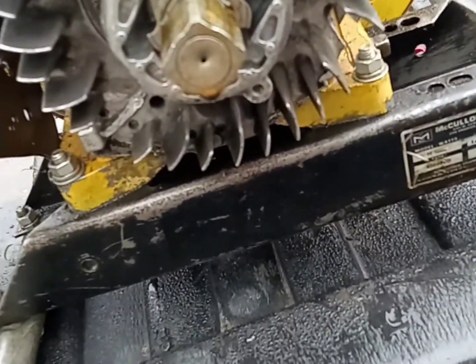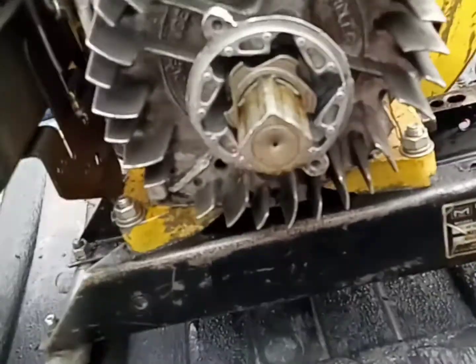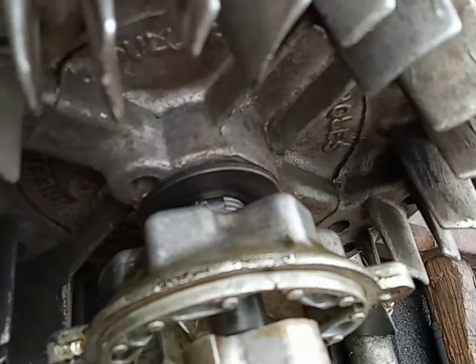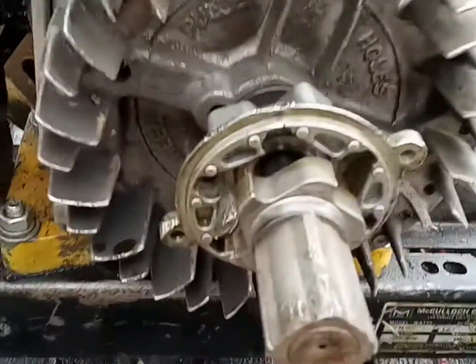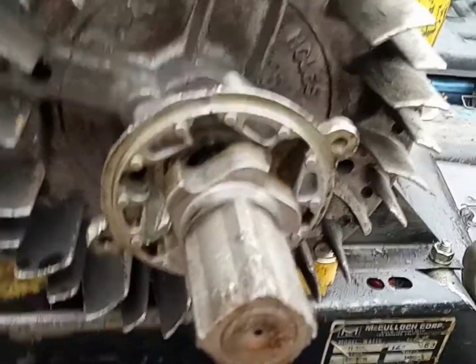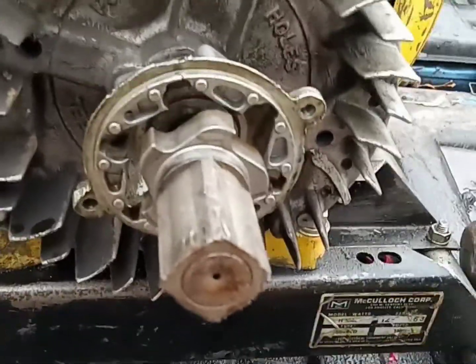I don't like the way that's turned to colors — might just be oil or whatever but I still don't like it. Well, I've been at it for about a half hour now. We're making progress but it's slow but steady coming off of there. That thing was really really stuck on there bad — somebody had to hammer that thing hard. I'm using my vise grips a little bit. I did throw a little more heat at it because it was just oil coming out of there, and I've been throwing a little bit of lubricant in there.